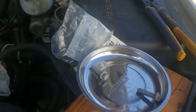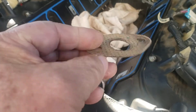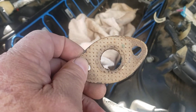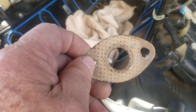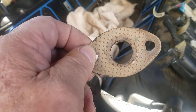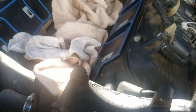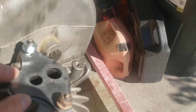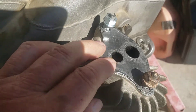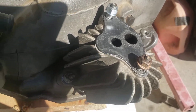If you have the California engine, when you put it back in, this is the articulated metal pipe — it's not a breather hose, it's actually an articulated metal pipe. This comes with the gasket set. When you get the Fel-Pro manifold gasket set, this piece comes with it. What doesn't come is a gasket for the EGR valve, so that gasket is going to be original. I don't see any breaks in it, so I may put some gasket maker around it and then install the EGR valve on top.